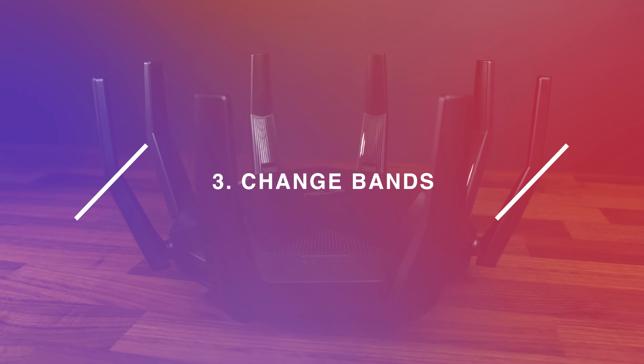Number 3: change bands. Since WiFi 4 in 2009, both the 2.4GHz and 5GHz bands have been available for wireless networks. Generally 5GHz is faster, but it's also shorter range — it's a trade off. I've set my home network up with separate 2.4 and 5GHz networks. Devices far away from the access point are on 2.4GHz for better range, while everything closer stays on 5GHz for better speed. Having all your wireless devices on different bands also helps reduce interference.